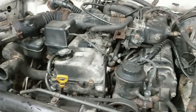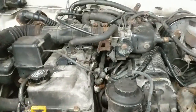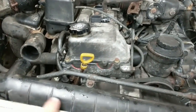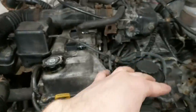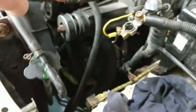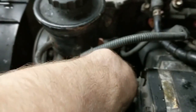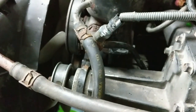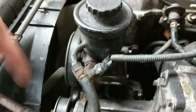So first, I've disconnected the top and bottom radiator hoses, so that one's down here. I believe normally coolant flows into the top of a radiator, comes out the bottom, and then up through the engine and such. So to back flush it, we'll want to squirt water down this way through the engine, and it will come out the hose down there. Now in between there is a thermostat, and it's down in here — I did have to remove that because when cold, the thermostat's shut, so you want to take that out so the coolant can flush through.